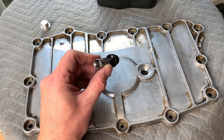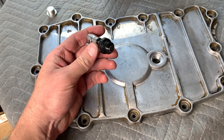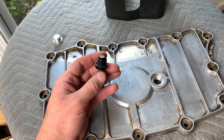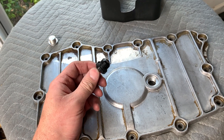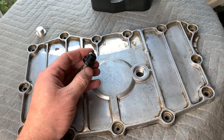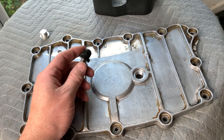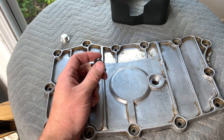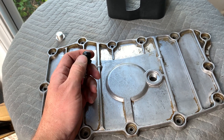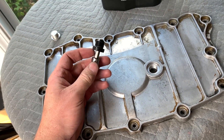The car had just had an oil change when I bought it and they put on an LN Engineering magnetic drain plug. I had remembered on Rennlist seeing a few accounts of people buying these plugs and experiencing some leaks, so my first thought was I have a bad plug and I need to send it back to LN. But since the oil wasn't a lot, I decided to keep driving and just clean the oil up — every time I drove it, the oil would get hot, come home, create a puddle, then as the car cooled there would be no more oil.